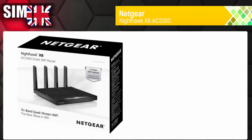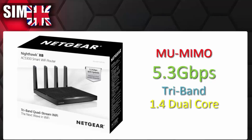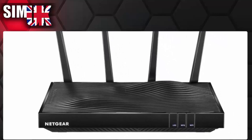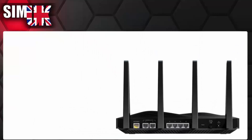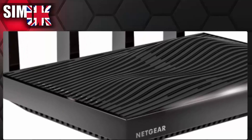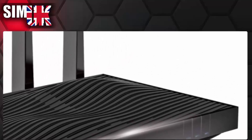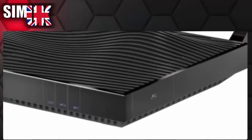Netgear's Nighthawk X8 AC5300 is an extremely stable router, and it is the first ever router configured with the fastest current Wi-Fi standard available, AC5300. It has an impressive set of internal settings and features, but comes with a hefty price tag. The X8 AC5300 is without doubt a feature-filled device, possibly to the point where it is too feature-rich for the average home user and is perhaps better suited to a business user instead. This router has superb Wi-Fi stability thanks to four external and four internal active antennas. It comes with not four but six gigabit LAN ports plus the WAN. With its sleek design and undulating vents, this is a router which suits some but not all in terms of aesthetics. The router has one USB 3.0 and one USB 2.0 port, interestingly located on the right-hand side of the router — a unique feature which may not suit everyone — but whilst not in use, there is a flip tray to hide them.